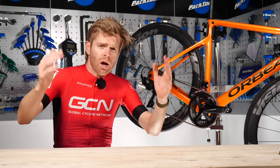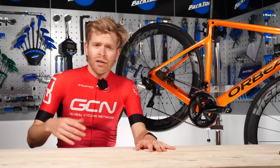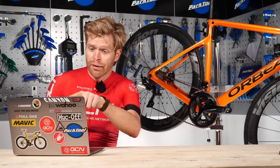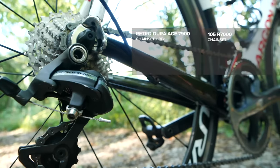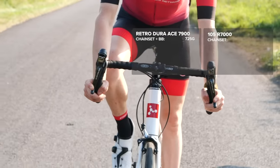First up, what are the weight differences between our two groupsets? Well, I've got them all written down, but I'm not Rain Man. I can't just remember them off the top of my head. So I'm going to bring in the laptop now. First up, the chainsets, okay? So, Dura-Ace 7900, that's 725 grams for that five-arm chainset.